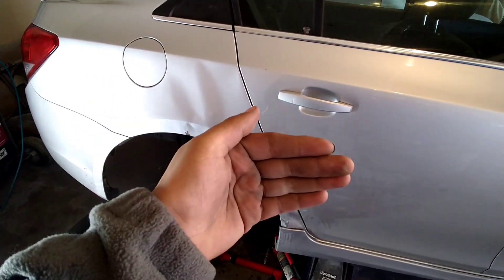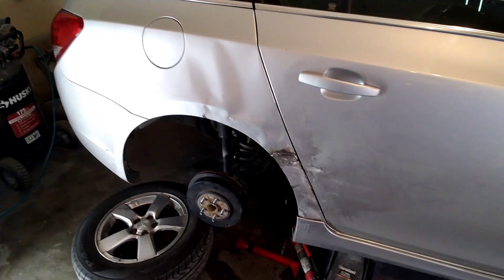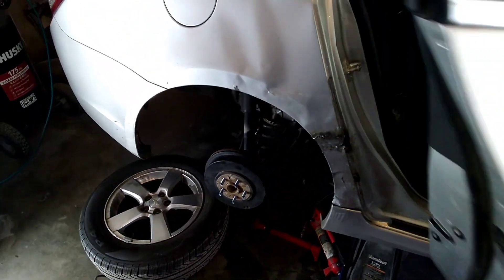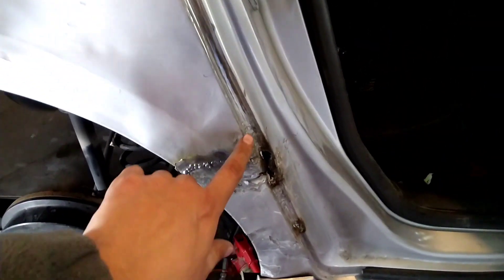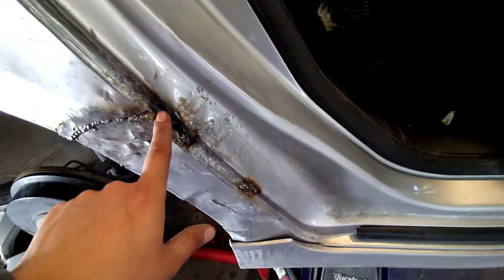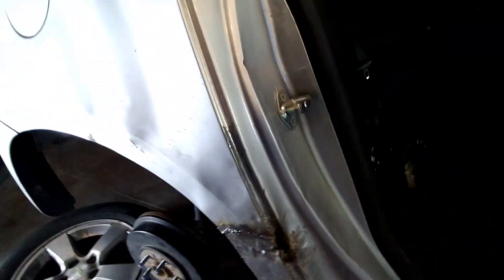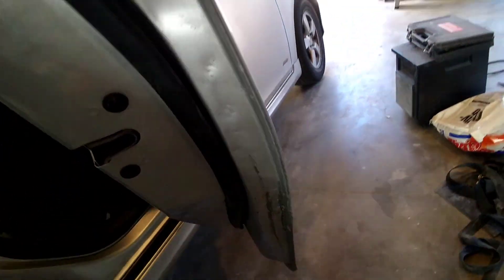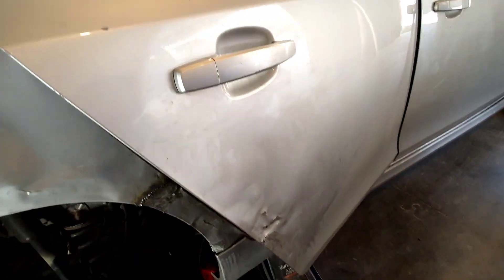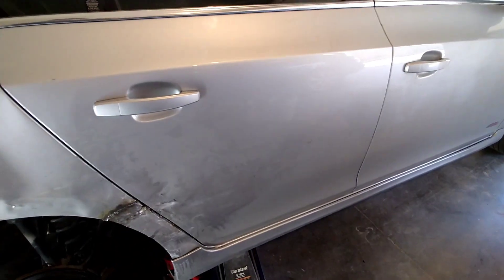The wrinkles are still there, but those aren't from the impact — I'm not sure what's going on up there, but we are going to pull them out anyway and make it look beautiful, just OEM. We already have it all lined up. We did need to pull a couple spots right there. We still got a little bit of welding right here — we'll plug that hole up, we already plugged this one up. It looks a bit ugly but it is lined up where it's supposed to be. As for the door, we still need to do a little bit of work on the front because there's a curve on the other side that this one doesn't have yet. Almost there.